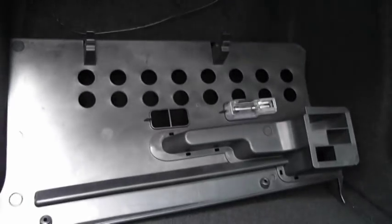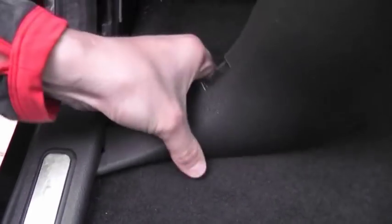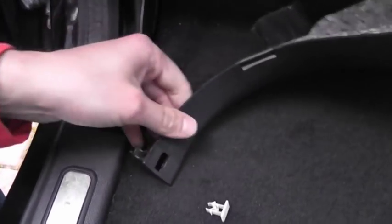The proper way to do the full job would require removing the seats to take the whole foam section out, but for now I'm just going to peel back the carpet and push the seats back. To take this panel off there are two retaining clips just here and here - this should be able to come out. Then you need to remove the wire attached to the footwell light. In here we have the top of the SAM - this unit with the barcode and lots of wires. The side panel comes out quite easily but is held in place here.